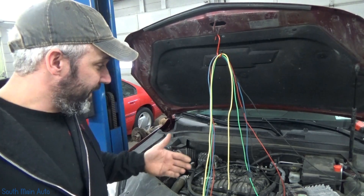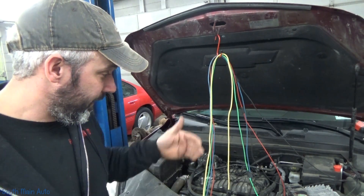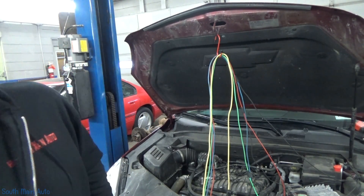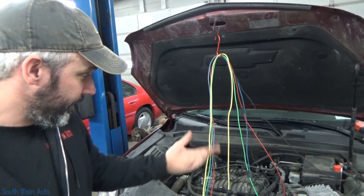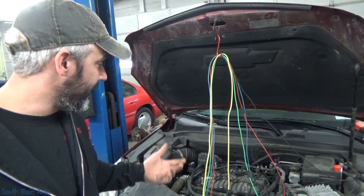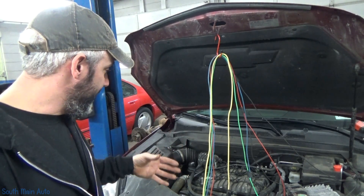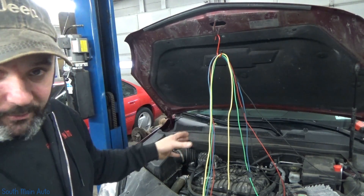So with all that seen, a quick test — and we didn't have to pull the timing cover. We had a look without pulling anything apart. All I pulled off was a small plastic cover off ECM connector X3 to grab my wires. Now we know with confidence that when we go in there and call the customer, we get the updated timing chain kit, the guides, and the phasers — everything GM has updates for — and we're not going in blind.